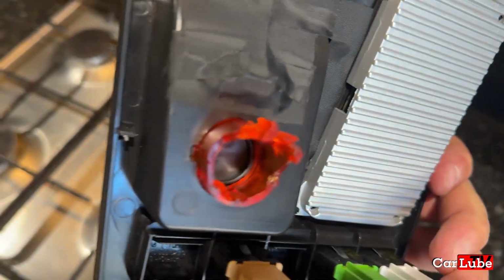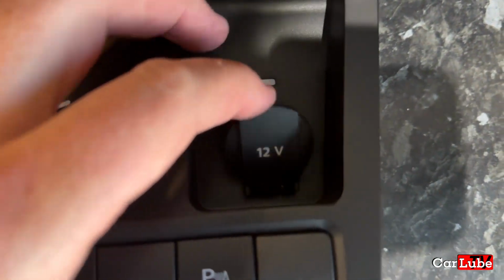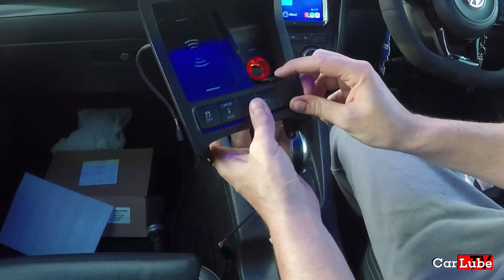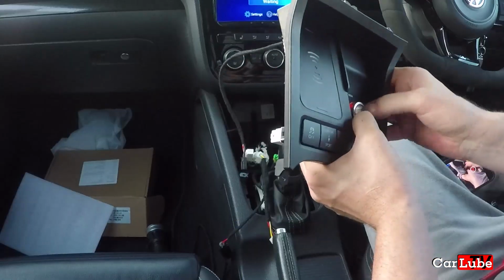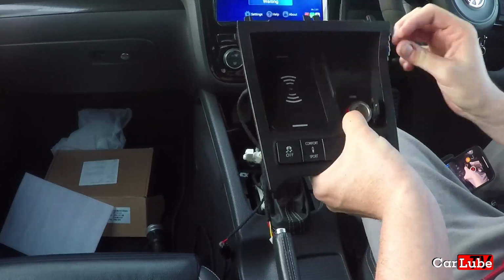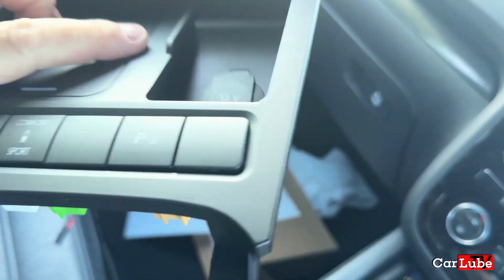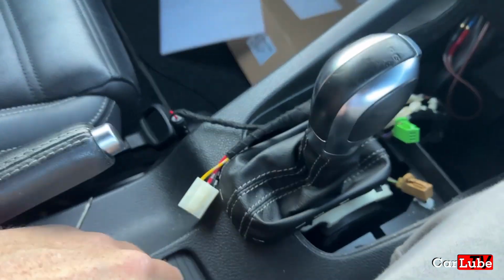It doesn't spin, and I've removed as many of the burrs from the burning as I could, but this now is perfect. It now opens and is fully functional, back in the car, and all we need to do now is reinstall the barrel, which is this part here, back in to the hole. So let's do that now. In you go. Okay, let's get that in the right way as well. Okay, orange part is in. Now let's push the silver part through. Great success. That is now seated properly and solid.